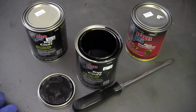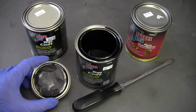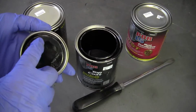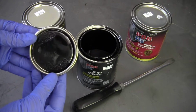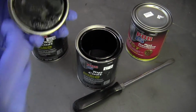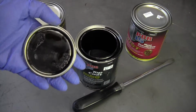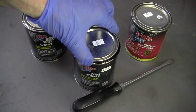But the very first thing you do when you get this open, or after you pour some, is clean that really well. And it's even more important to clean off this lid, not just here, and not just here, but you have to really get into that groove right there. That's the main thing, because anything that settles in that groove, and you can see some in there, matters. Even if you got this spotless and this spotless, if there's any in that little groove, as soon as you put that back on, it's making contact with this lip, and if it's tacky, over time it's going to dry, and you're not going to be able to open it again. So you've got to clean it just as soon as you open that thing.